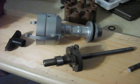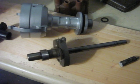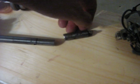I'm just making a video here of the modifications I had to make to the V8 distributor for use on the Frankenbriggs 4. The first thing I did was to cut the drive shaft back so it doesn't stick out so far from my coupling on the engine.